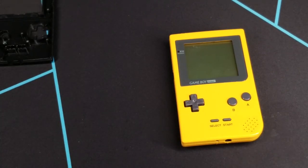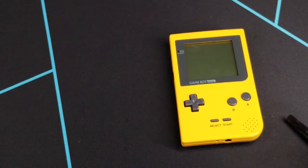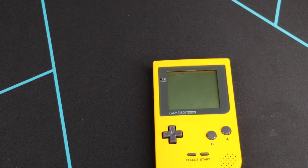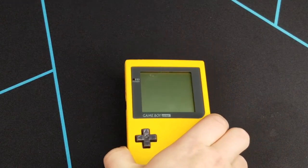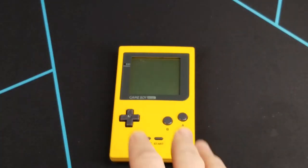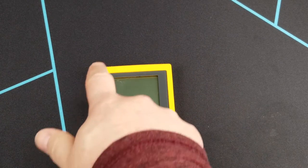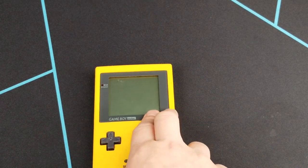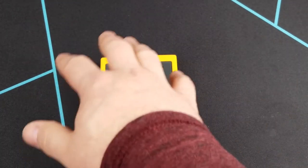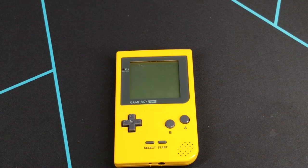But let's say you don't want to do that — you don't feel comfortable taking it apart, you're not great with electronics, but you want to replace your screen lens. Another method I've found very reliable is to take a hairdryer on low heat and do circular motions around the perimeter of the old screen lens to loosen the adhesive. Eventually it'll loosen up enough that you can remove the protector.